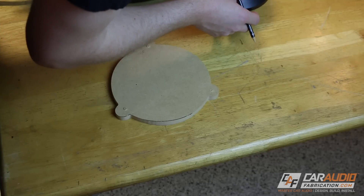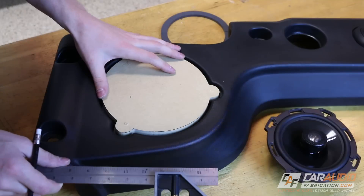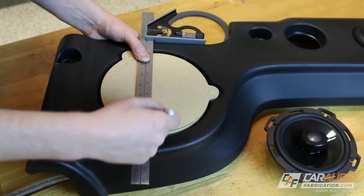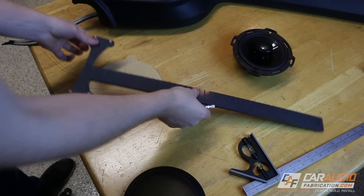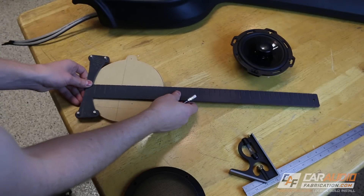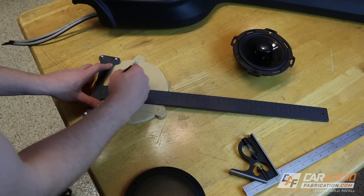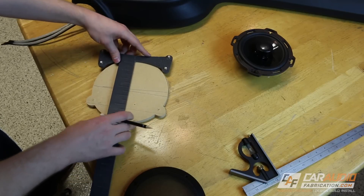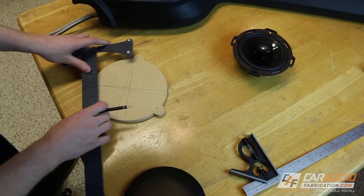Now I have my factory grille completely copied to a piece of wood. I did a quick check to make sure my new template will fit on the sound bar, and sure enough it does. Here I'm drawing a quick line just so I can remember the orientation of the adapter once it's in the pod. Next I need to find the exact center point of my new wooden template, and I'm going to use this cool tool from my show sponsor Mobile Solutions called the Cross Arc. This tool has pins that allow me to draw a line that's 90 degrees from the edge of the circle, and by drawing two of these lines, the point where they cross is the exact center of the circle.